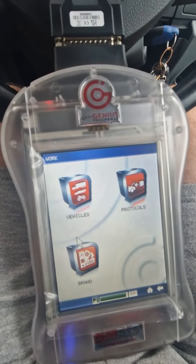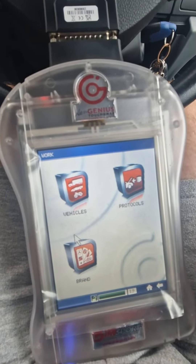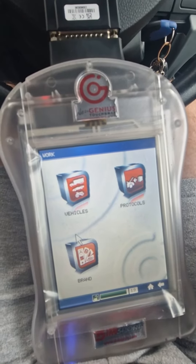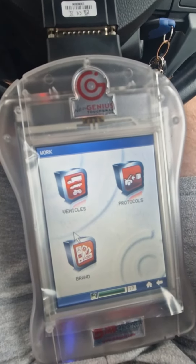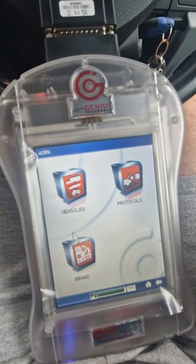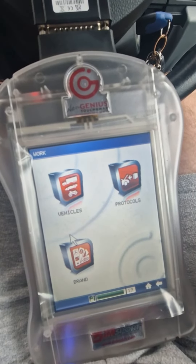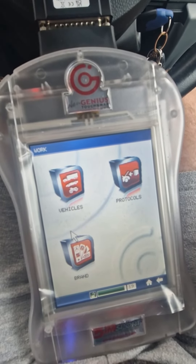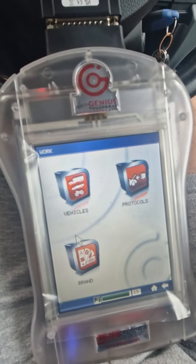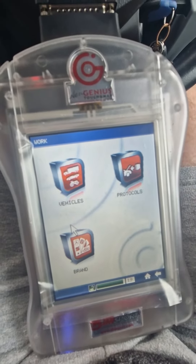During the test drive I'll be recording the live data and reviewing it to ensure the vehicle is healthy and safe to pass back to the customer. I'll also take a log of any current fault codes — that could be anything from body control modules, but specifically I'm looking at engine and gearbox control modules — just to have a reference of how I handed the vehicle back to you on the day the tune is completed. Overall, that's me: stage one done.